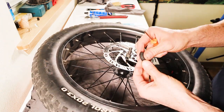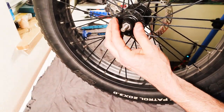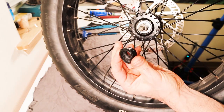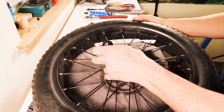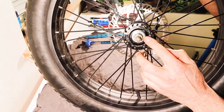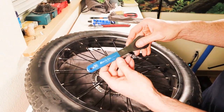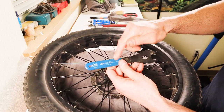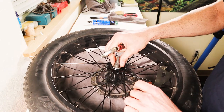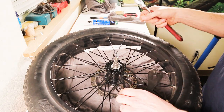Go ahead and dig out the little rubber dust caps. Here's the smaller one that's on the side with the disc brake rotor. And then on this side, there's a bigger one. If you kind of squeeze it first, you can just dig that off. So we're taking this little rubber gasket thing off and setting that aside. The way we're going to pull the axle out is you're going to need a 15 millimeter cone wrench — I'll leave a link in the description to one of these — and you're also going to need a crescent wrench. This nut is 17 millimeter, so if you have a 17 millimeter wrench that works; I just use a crescent wrench for this one.